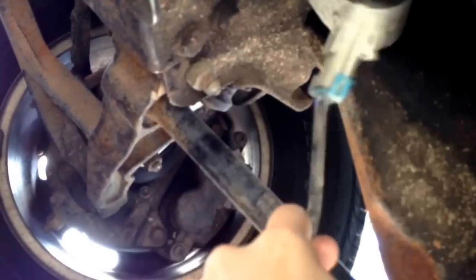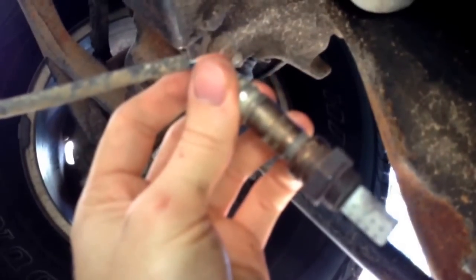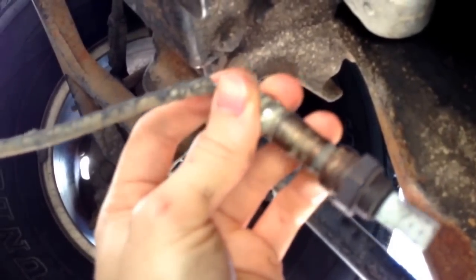Most people who replace these would probably go with Bosch because they're easy to find; you've got to look around for Densos. Both of mine were still Denso, so they're probably the originals. There's where it was, and the plug was just laying in there — it was not clipped in and the little clip piece was missing. But I've got a new clip piece on the new sensor. I need to find where it's supposed to clip in because I don't want it just laying in there. Going to screw in the new sensor — I've just enough room to get the open end in there and tighten it up.